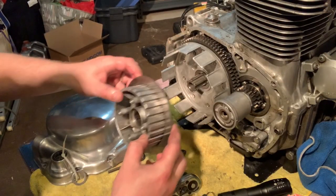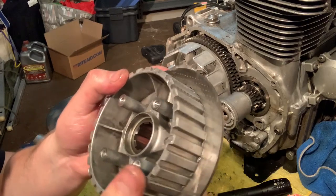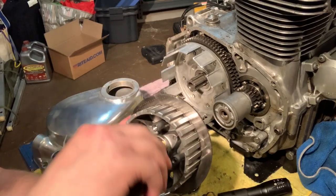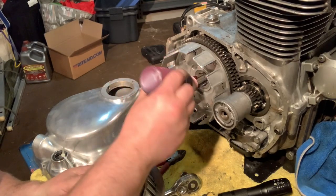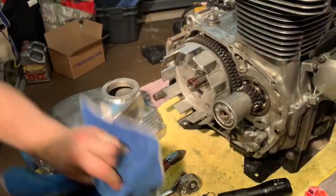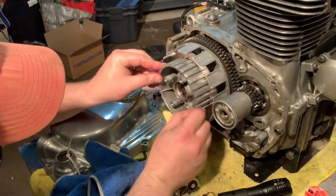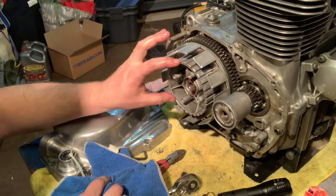With our test done on our plates, we can go ahead and get this basket installed. Take a look at that — this is actually really clean, not a ton of corrosion. I'm going to go ahead and drop a little bit of assembly grease around this. Throw some assembly lube on there, wipe my hand, and then we can insert this. It doesn't matter which way it goes — just make sure that you get the cogs in the wheel lined up and push that thing right on there. Now we can start to add our plates.